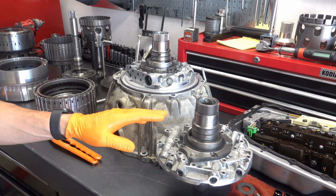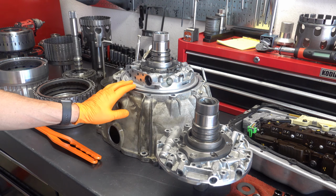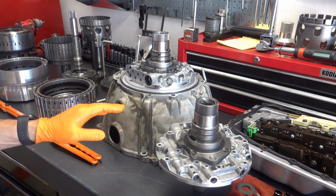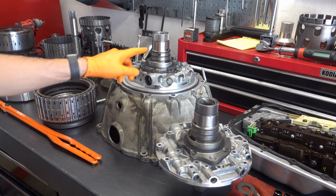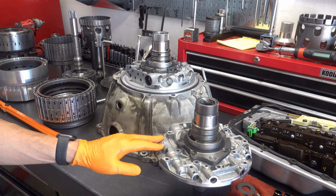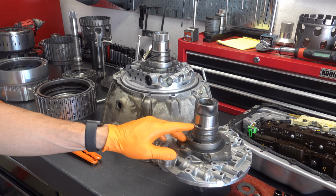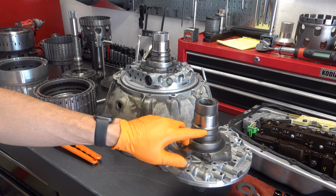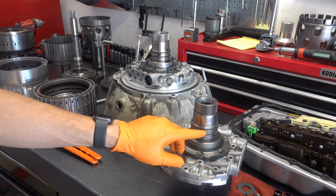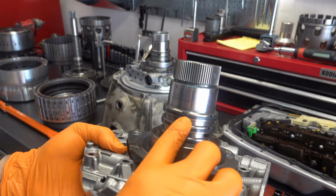Alright, so as you can see, you have two different stator pump cover assemblies on the bench. The one that's bolted to the pump body / bell, and then this one here. So if you look closely, these two stators around in the sealing ring area are not the same. In mid-2009, they changed the design of the sealing rings and the sealing ring grooves to accept what we call support O-rings underneath the sealing rings, and then they also machined in two cutouts or lugs for locking tabs.